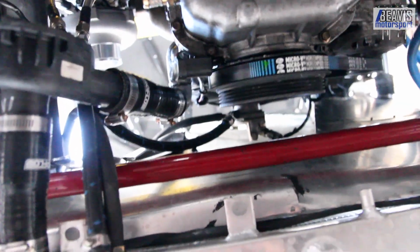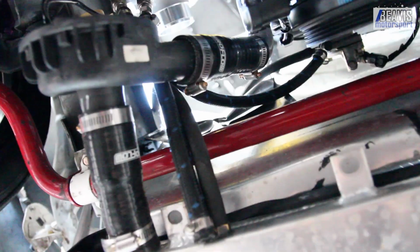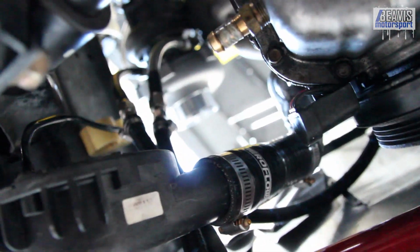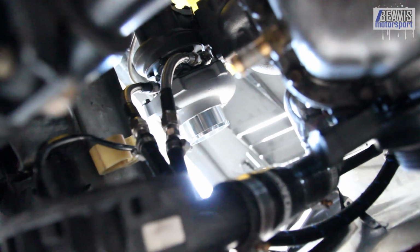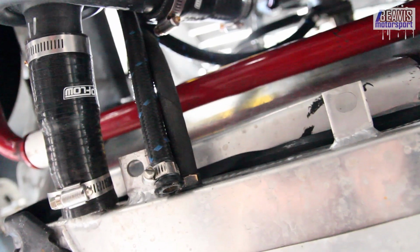So, we're now under the engine. I thought I'd start by talking to you about what's been going on and where things are going from this perspective. So, firstly, we've got the two coolant lines. Let me try and focus those. The two coolant lines here, which are the two braided stainless lines, these two. They come stainless braided to this point, then there's two barbed fittings here. One of these lines now comes here to the radiator.